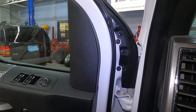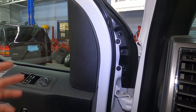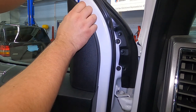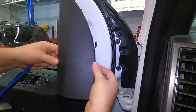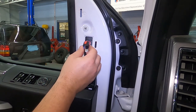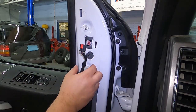When upgrading, you want to make sure you ordered the right mirror. Fords have either an 8-pin or a 22-pin connector for the mirrors, depending on your trim level. With a door panel tool, pop the clips — one up top and a couple on the sides — pry gently and it snaps out. There are four little clips under the door. The more square-style connector is your 8-pin; the longer one is the 22-pin with more features.